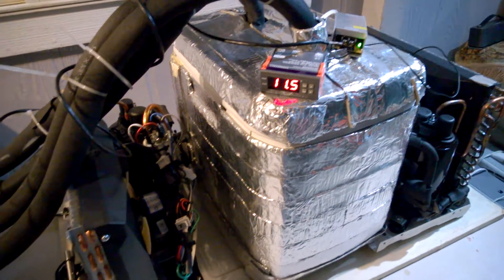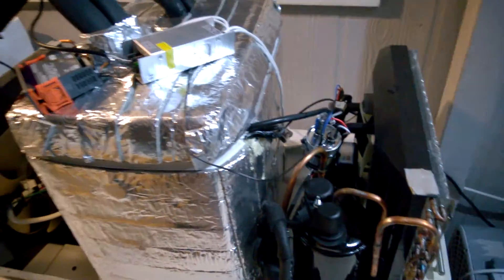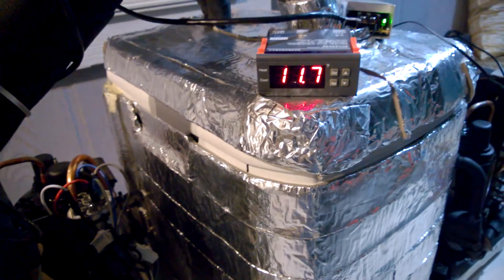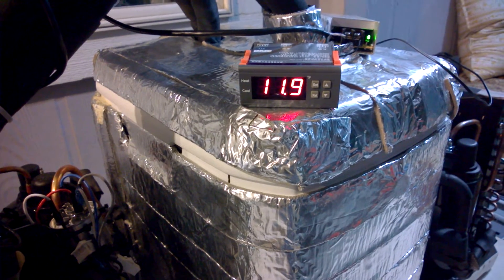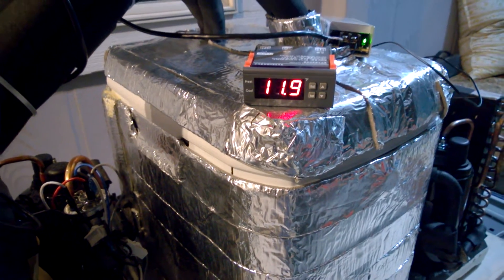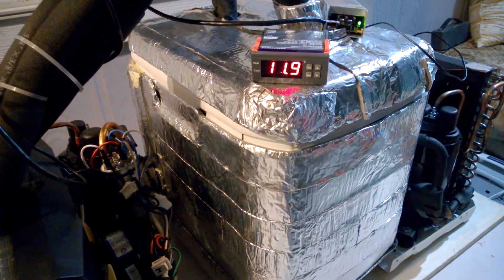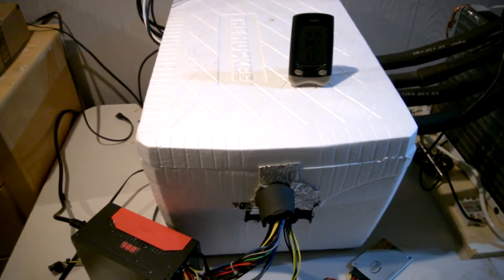Here's the little air conditioner unit chiller that I just built, and that's the chill box. I set the temperature to 10 Fahrenheit, and when it goes up to 12 Fahrenheit it automatically kicks in and brings it back down to 10. It's going to kick in right now — it's running Prime95 on the computer to generate some heat on the CPU. The computer's inside the box.